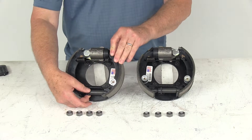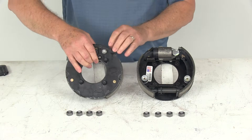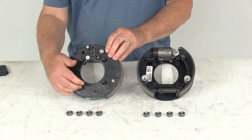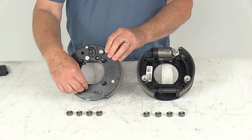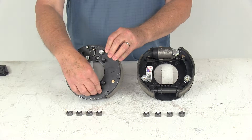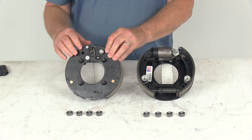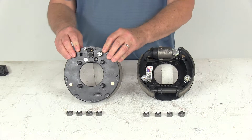Right down here is your adjustment gear where you'd adjust them. On the backing plate there's an access hole at the bottom that you put your tool through to do your adjustment. What's nice on these brakes is they have an adjuster plug that goes in there when you're not using it, so that hole is covered up. This keeps any dirt and grime from getting into your brake assembly and off your brake shoes.